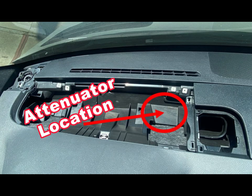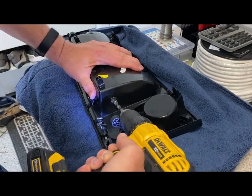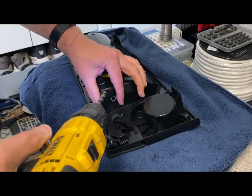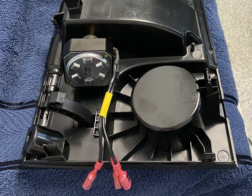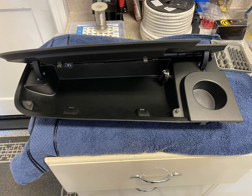There is a considerable amount of free space underneath and behind the cup holder on the driver's side storage cubby. We drilled a small hole through the plastic sidewall and installed the attenuator with the hardware that was included with the product. The length of the attenuator post is adjustable, and the knob was positioned appropriately within the cubby.